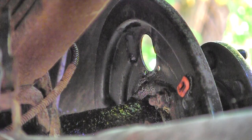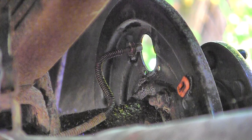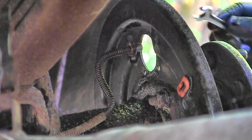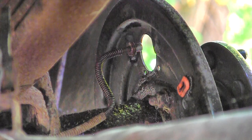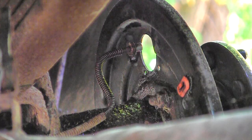All right, so I did a couple things off camera here besides clean the plate. I actually put just a small dollop of anti-seize on the end of the nut on the brake line, and I can see a little bit of gunk on the end of that brake line. I'll make sure I get that cleaned out. I also removed the bleeder valve from the new cylinder so that I can spin it in there without catching the line or anything. It may or may not be a problem, but I think it'll help. And also put some anti-seize on the two nuts that hold the cylinder to the plate.